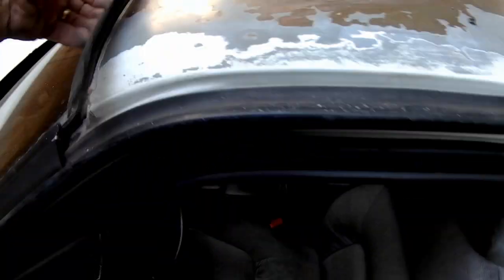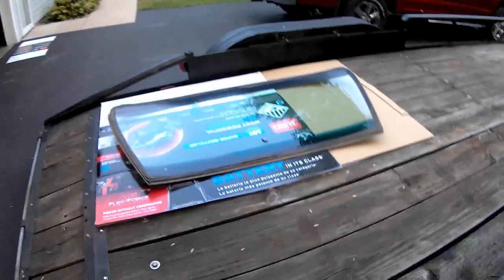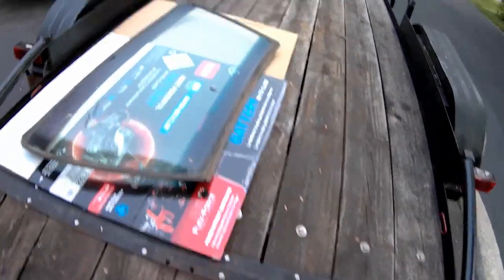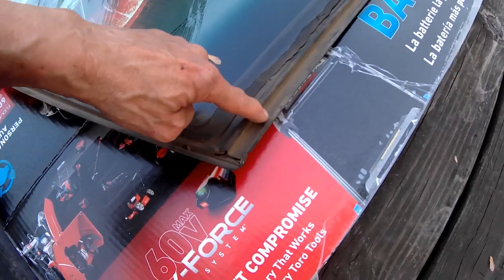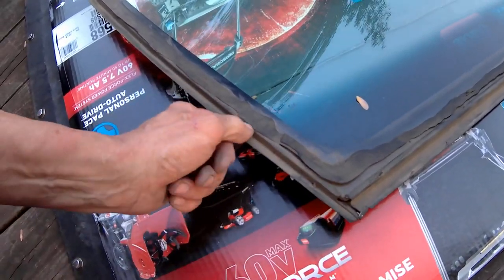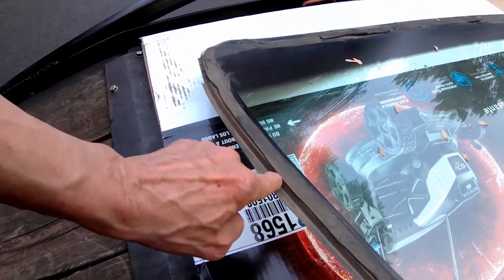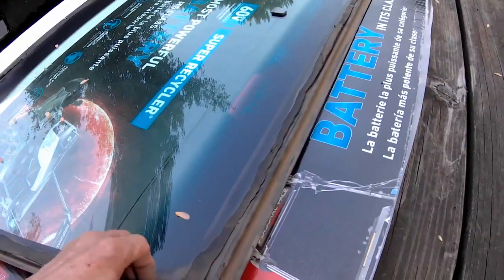Now this one is chipped up. Fortunately, when I got the old windshield to replace it, it has a decent top piece. I got one good top and the side piece on it. This is the used windshield I'm throwing in. These are how the trim pieces go in — the top and the side — and they get a little bit of glue on them, but not enough that they won't come apart. If you've got to get these out, you need to get your razor blade or scraper in there and get the glue off the trim so you can get the glass out.